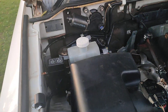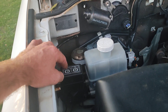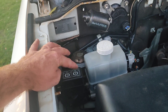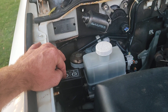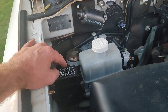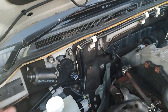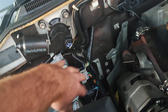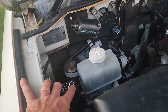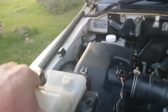Generally on my model there are two relays, and as far as I can figure out these are redundant relays — if you pull one, the other will still work, and vice versa. They work together to share the load so you don't have too many amps going through a single relay. The signal comes from the ECU, which is in the footwell under the radio on the other side of the firewall. There is also a built-in control board on the side of the pump.